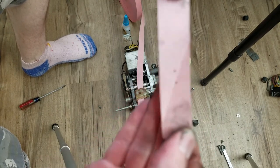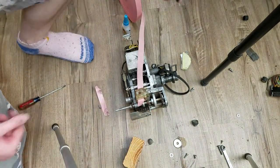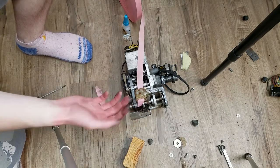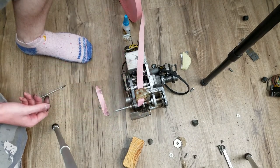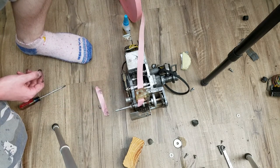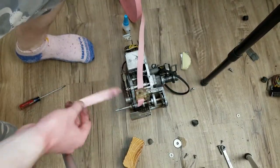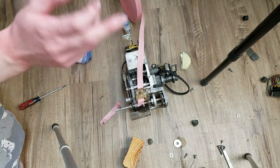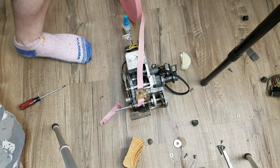There you go - it's got two holes anyway. I'll just play around with that. There should be a way to release the other punches, because probably there's just a relay or something that will release each individual punch as you turn that over. I might play around with that and make sure all the other punches are going to work. First punch in - who knows how many years. So I've got to find new tape and see if I can get the carriage assembly back in once I reconnect that strap, and then see if the spring is going to work.